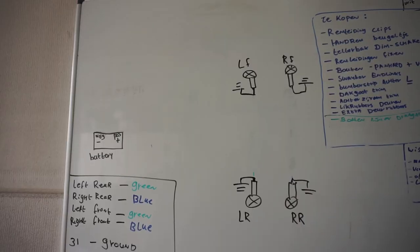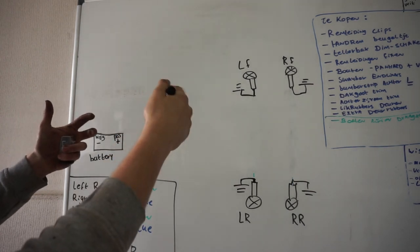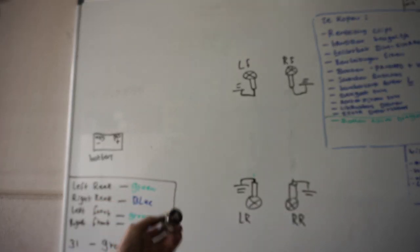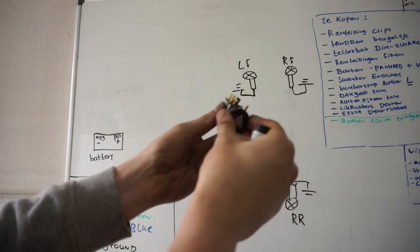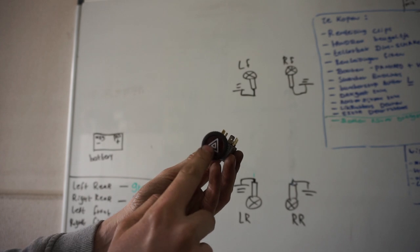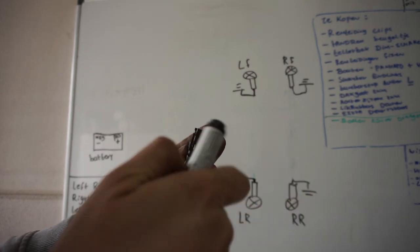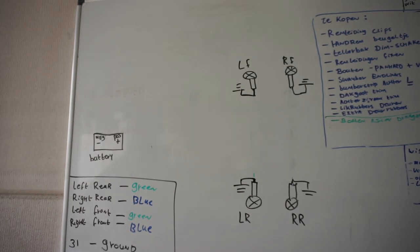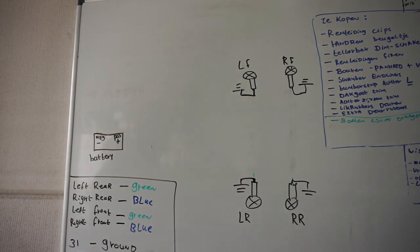Here's my whiteboard. I'm going to talk you through how you make one of these schematics and how this exact switch works. The switch lights up when you pull it out — it has a small light when your ignition is on and a blinking light when the hazard is pressed. As I said, this one uses your original blinker relay, so you don't need another relay. You could buy a separate relay, but why do that when you can do it the easy way?